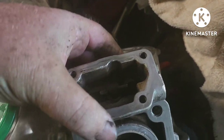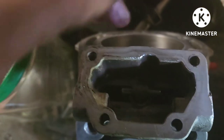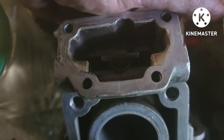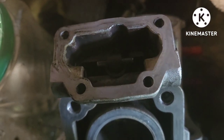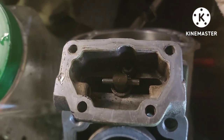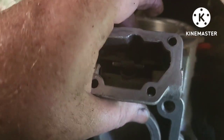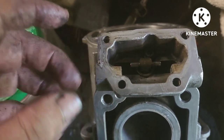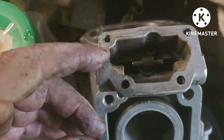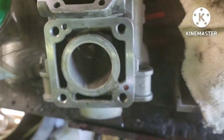Once you've got it out and cleaned it, put it back in. Make sure you use loctite on your allen bolts so they don't back out, and you want a free-moving valve — make sure you don't have any carbon build-up causing it to bind up. Anyway, that's how you rip the gears out of your motor: when those bind up with carbon build-up, it tears the gears out of the motor that actuates them.